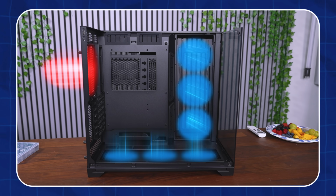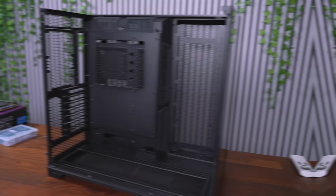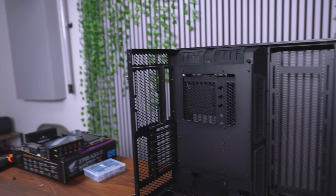So let's say we flip those and make them exhaust instead. Well, now you're gonna have intake, exhaust on the side, and then you have exhaust on the left side as well. Well, there's actually one more option. We can lower the motherboard tray and make space for an additional 120 millimeter fan in the back, which is what we're gonna do. So one thumb screw here,